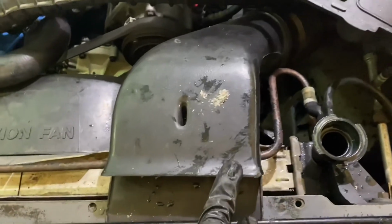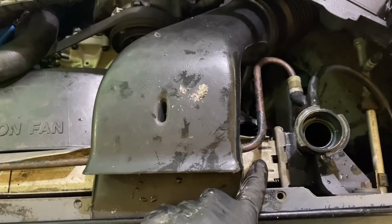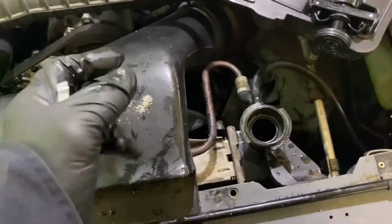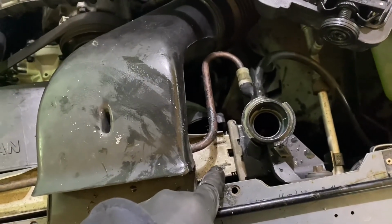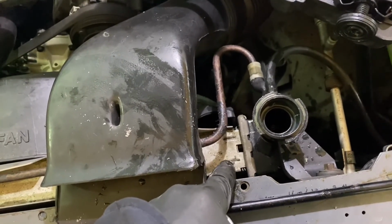As far as checking the radiators, if it's an aluminum one, you never put it in the same tank that you had a copper one in, because the solder can have corrosive flux left over on the radiators, and they can eat up the aluminum radiators. And also they would submerge these in a tank and pressure them up, just the radiator itself, up to 21 pounds, and look for bubbles, and that would be the maximum.